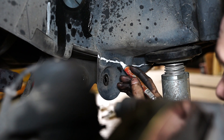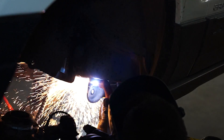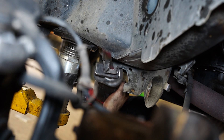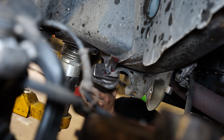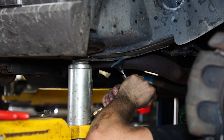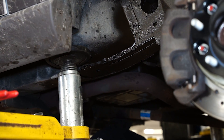The next step is we're going to be cutting the lower control arm pockets off the WJ. A Sawzall cutoff wheel is not exactly the best or most fun way to do it — I had to do it because my plasma cutter decided to die on me this day — but all that proves to you guys is you can do it with your tools. Once you get those control arm pockets cut off, make sure you grind clean, paint, undercoat, whatever you want to do to protect the bare metal you just exposed.